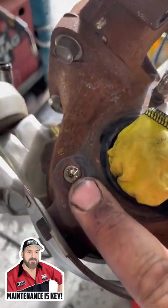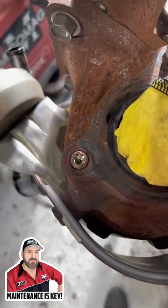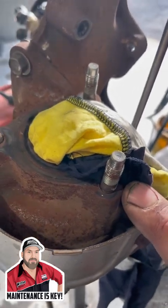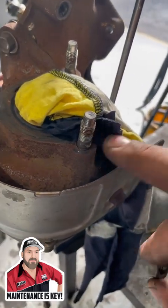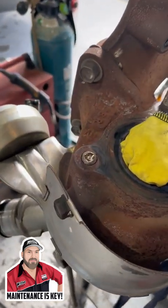Alright, here we go. We've got the stud. I've drilled it out, but because it's off center, I'm not going to keep drilling because I don't want to damage the turbo housing. These studs here, I don't know yet if I'm going to clean them up or try and get them out. It's probably a 50-50 shot on them, so we'll just be a bit careful.